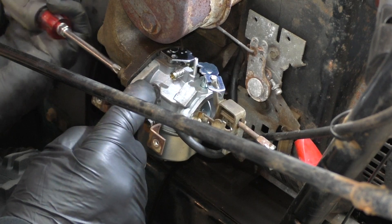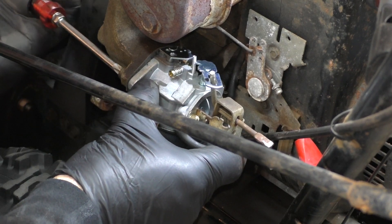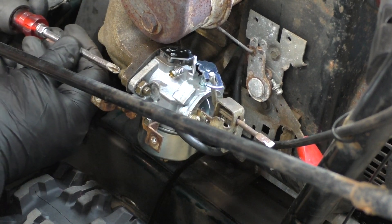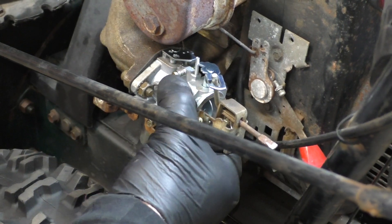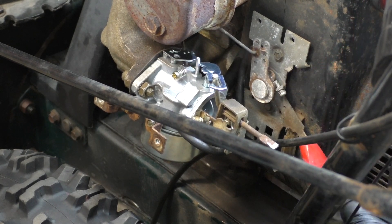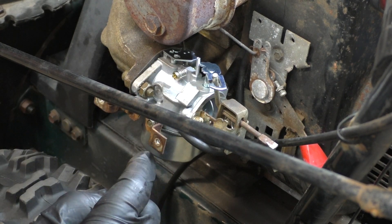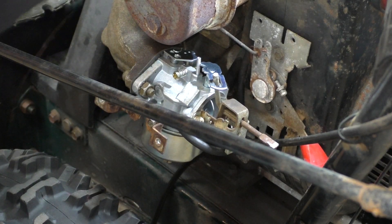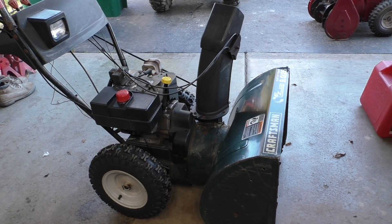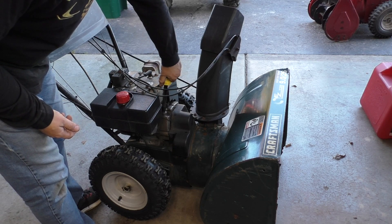Snugging this up — don't have to go too crazy, we're just pinching that gasket. That looks snug. Now it's going to come to — choke works. We're going to put the cover back on, but before we put the cover on, we're going to run some fuel in this. New fuel, ethanol free — get it running and then do our fine-tune adjustments. Let's check that oil. There was oil in it when it arrived. We're at the add mark, but that's enough.